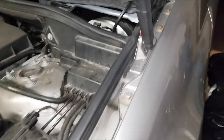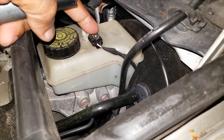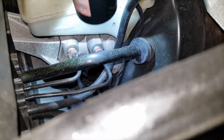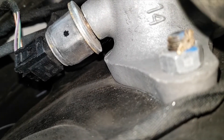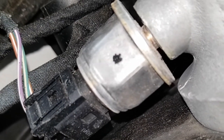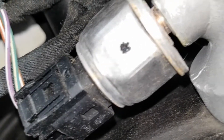I'm on the right side of the car and there's a sensor here that's for the level. We're not focused on that — we're focused on another sensor. It's right there. There's a plug on there; sometimes that plug gets corroded, sometimes it may get some liquid or moisture in there. So that's the pressure sensor right there for the ESP module.